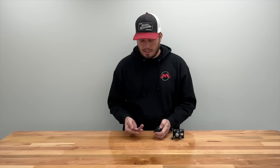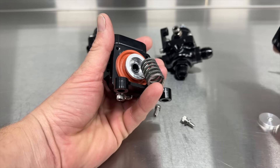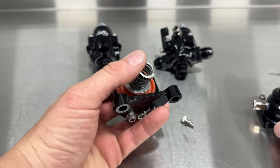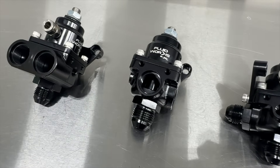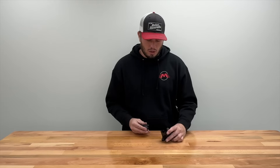Here is a pretty good visual. This diaphragm seals right here in the top lid of your fuel regulator. Everything on the top is basically pressurized and has a spring and that set screw. Everything on the bottom is going to be fuel related. They are a divided system — air on top, fuel on bottom. If you're looking for a new fuel pressure regulator, obviously we love the Fluidworks stuff. We have several different variations with different inlet styles: a dual inlet in the front, a traditional 180-degree where it has a fitting on each side, and a 90-degree one. This one is made to allow you to mount it right off the end of a fuel rail. All three of these have the same internals.